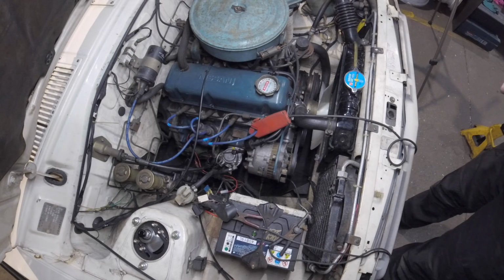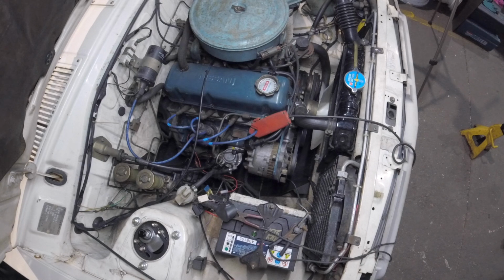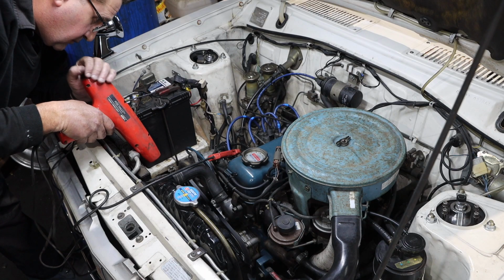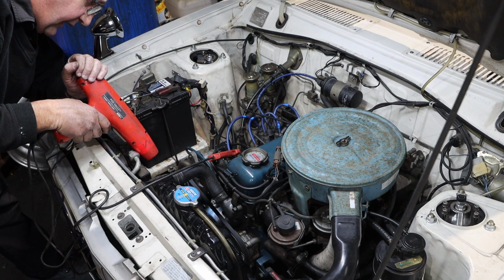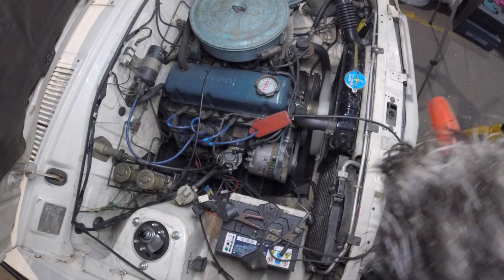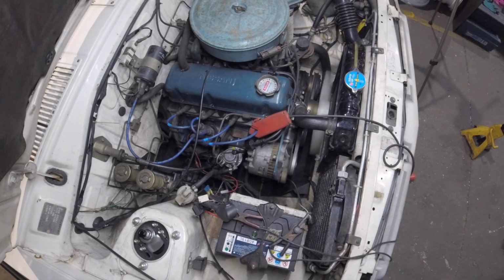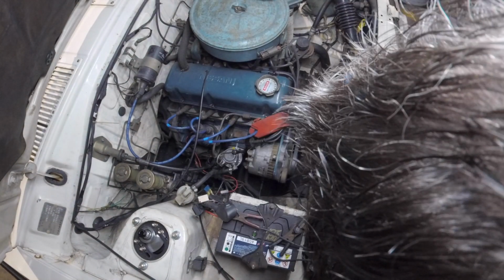Consult Datsun 1200 Club. Datsun 1200 uses base timing of 5 degrees or 7 degrees. Total timing is 30 degrees plus 2 degrees. So 5 or 7, so in there somewhere. Thank you, Datsun 1200 Wiki. Let's find out where we are. Oh! Yeah, that's a bit advanced. Like, not even on this car, it's about 30. Yeah, that's as far as it goes.